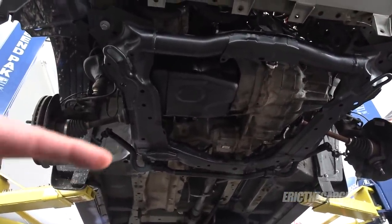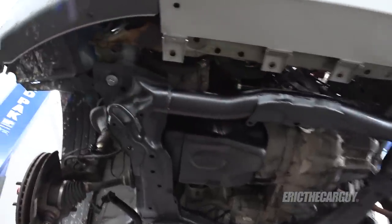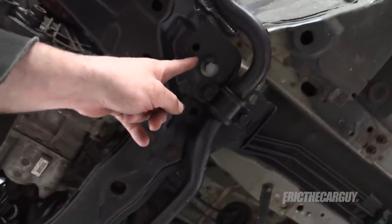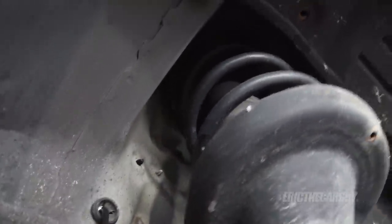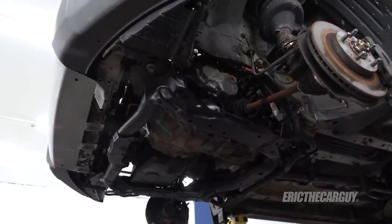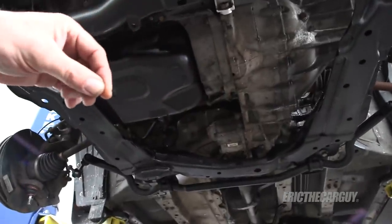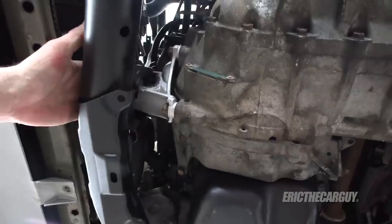It did seem a little easier to put up in there without the lower control arms attached, although what I've done in the past is I've hooked the ball joints in to help hold it in place while I run the four bolts in that hold it. I ran those through the sandblaster and then coated them with WD-40 to help prevent corrosion in the future. This gives it an OE look — at the factory, they put little paint marks on these to verify they've been torqued to spec. Not too much to do under here. I still have to fill the transmission up with some fluid. I did put some oil in the engine, and as I mentioned, I removed the old valve cover and drizzled oil over the top of the camshaft and the timing chain to try to get some oil down in there before I started up for the first time. New engine mount here in the front.